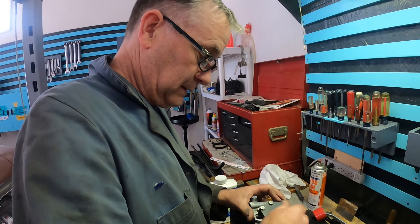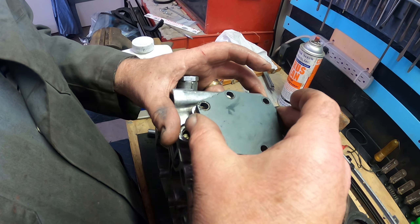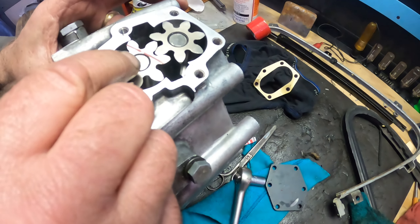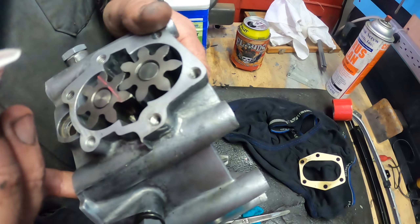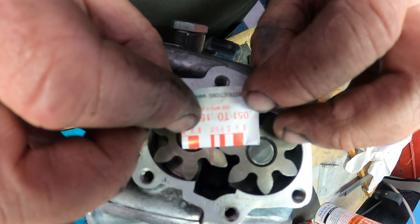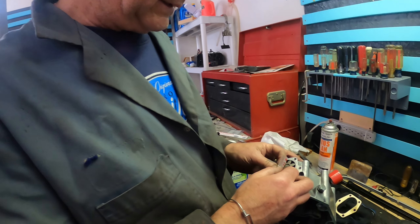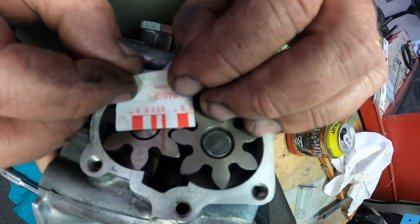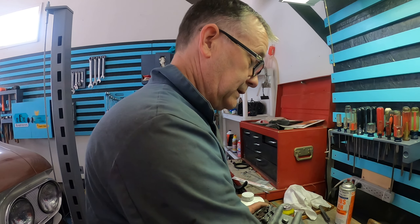Now I'm taking it apart. It is all squished — it got on there. And now I get my gauge. I think it's too much clearance. See that? At .006 — that's six thousandths of an inch. So that's not the right gasket. I checked the manual and it's supposed to be between two and four thousandths. I need to go with a thinner one.